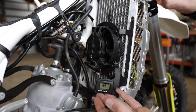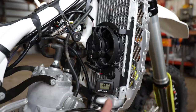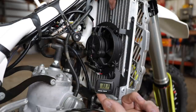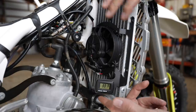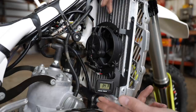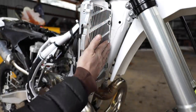This is a Trail Tech electric fan kit. There's only a fan on one radiator — that's all you need. It tied into the factory harness, just plugged right in. It has a little thermostat that shows ambient air temperature, and you can set when you want it to kick on. There's a copper thermostat sensor pressed in between the radiator fins. On a long hill climb when you're not passing air through, it comes on and cools the bike down immediately — tremendous insurance for protecting the engine.